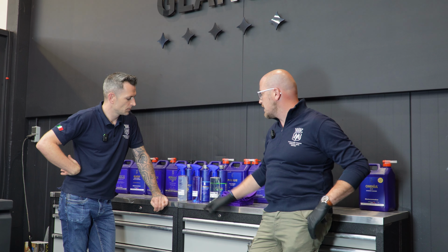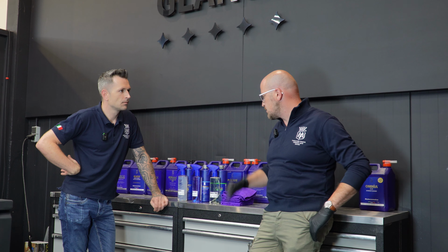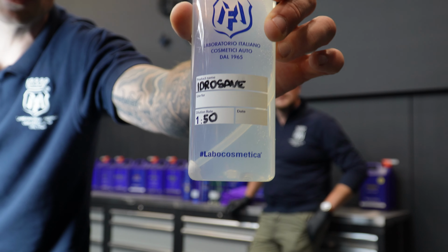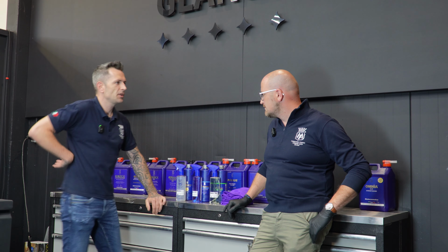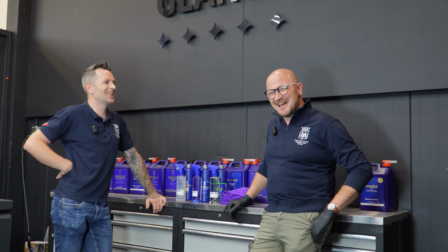And we use HydroSafe as the slick solution, the shampoo, the rinse solution. I think it's very interesting because, ladies and gentlemen, you cannot see this, but I will keep it close in the camera. If you can see this, the dilution is pretty stout. It's a 1 to 50 dilution. Please, Dino, tell me, why did you choose a 1 to 50 instead of the 1 to 256? Back in the days when testing the products, especially on the very delicate paints, and that's I think the nicest way to say it.